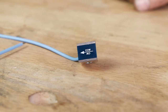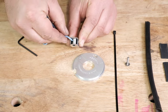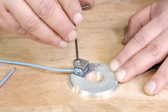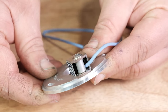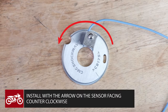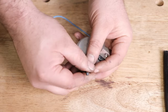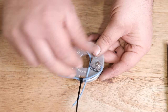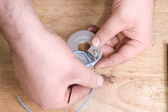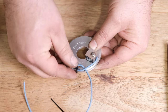In your Shockwave you will receive one sensor. These can be either blue or green but they are both identical. Insert the sensor support spacer into the sensor body and use the supplied sensor bolt to temporarily bolt the sensor to the sensor plate. This spacer is necessary to keep the sensor from moving and changing the timing on you, so be sure to install it. Run the sensor wire down to the machined hole in your sensor plate and use the included small zip tie to zip tie the sensor wire onto the face of your sensor plate. Then loop the wire up and behind itself to create a cable strain relief that will keep the sensor wire out of the way of the points chamber. Be sure to leave a small amount of slack in the sensor cable.